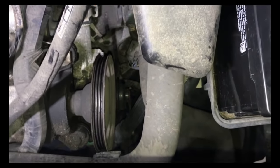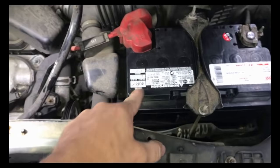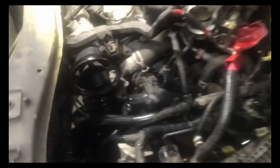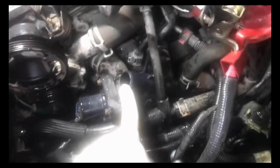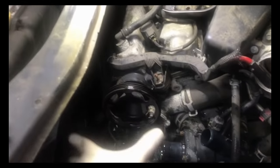So let me get some of the stuff we're going to do. We're going to take this air boot out of the way, this hose out of the way. I think I'm going to go ahead and pull the battery out also to give myself more room to get in there to work. So what I did is we took the battery out, the battery tray out, the air filter housing out over here. We took the upper hose off, the lower hose off. Now we have good room to get in here.